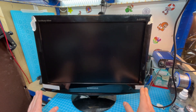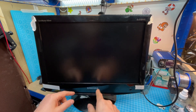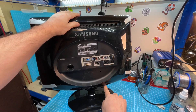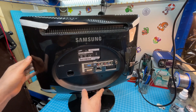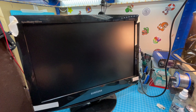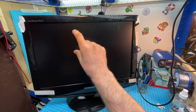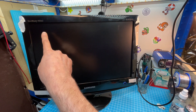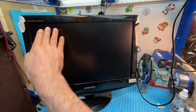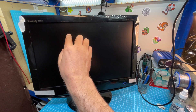As you can see, I didn't put it back together fully because it's held together with clips — there are only two screws in the back. To open it up there are two screws down here that you have to remove, then very carefully pry it open without damaging the clips. So first I'll show you the problem. Let's plug it in — you can see the picture comes on briefly, but then the backlight turns off. The picture is still there but the backlight is gone.